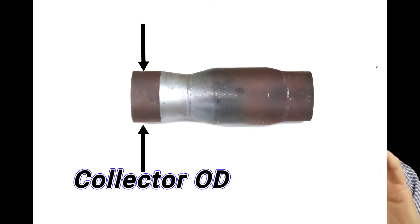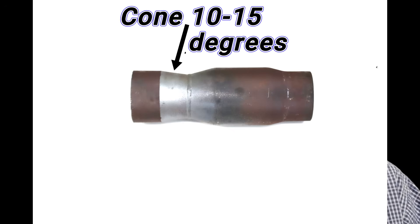It was interesting to see that there were quite a few people who swore by these anti-reversion collectors. We did try one at the end of a tailpipe about three feet long, one in the middle, one at the end, and one just on the end of the collector — so only about a foot long. Neither Greg nor I are going to bore you with repetitious stuff here. The anti-reversion device actually did work — not a great amount, but it's an almost zero-cost mod. It did work consistently, but only to a small amount.